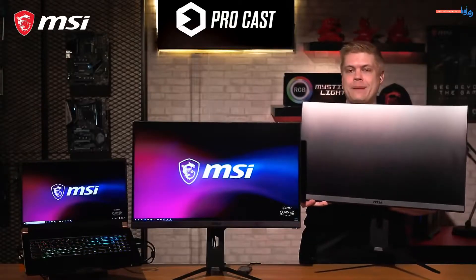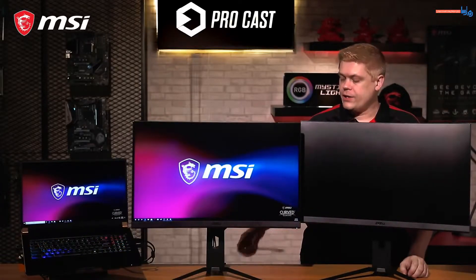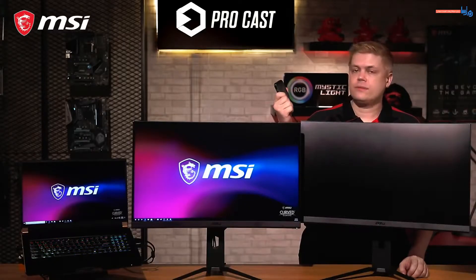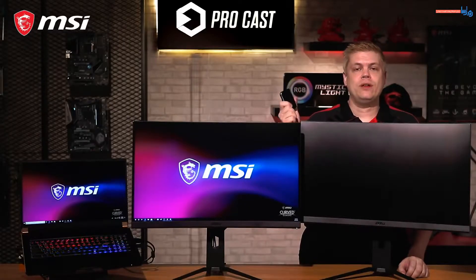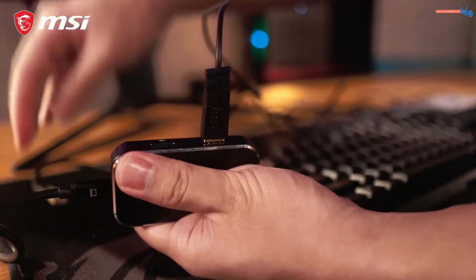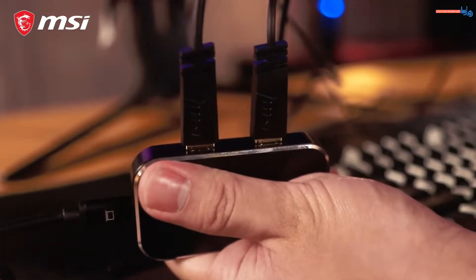To connect dual monitors to this laptop, we can use a USB-C to DisplayPort cable, or a USB-C to HDMI adapter, which is what we have here — pretty small, and with just one cable it also hooks up extra USB devices. We suggest USB-C 4K 60Hz adapters; they're newer, better future-proofed, and will support our 1440p resolution.